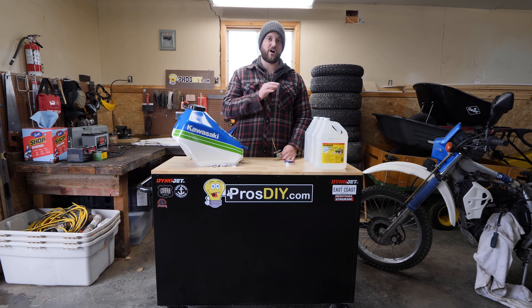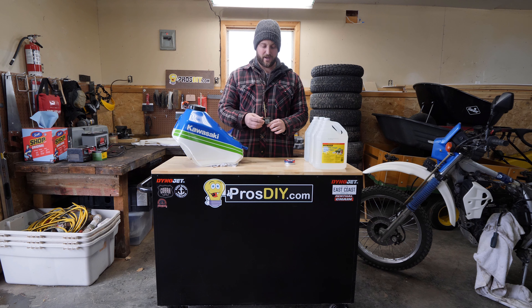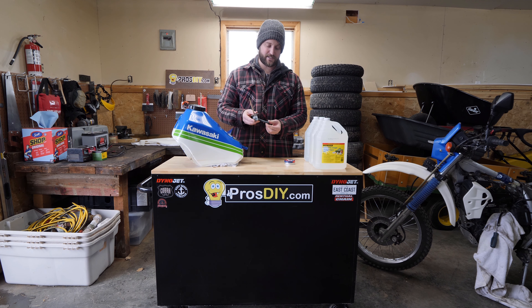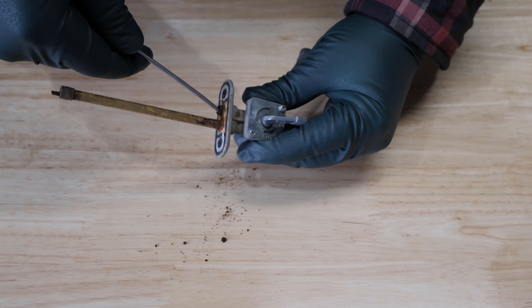So while the tank was still on the bike and the petcock was installed, I turned it to the off position, disconnected the hose at this end, put it into a bucket, and turned it on to the on position. The fuel supply was very slow, so I knew there was an issue with a clog within the petcock. I then turned it to reserve and there was no flow — so definitely an issue inside the tank. After a closer inspection, there's a lot of rust inside the tank and the petcock is completely clogged up.